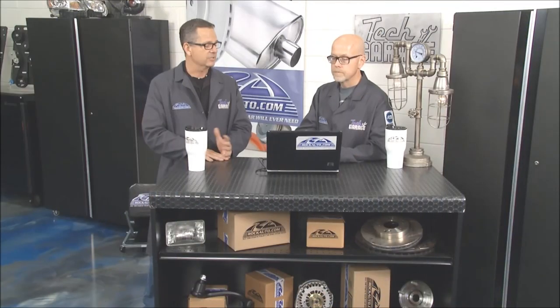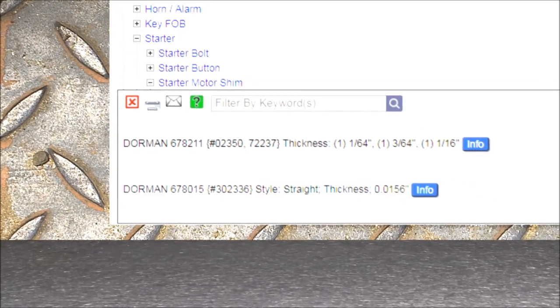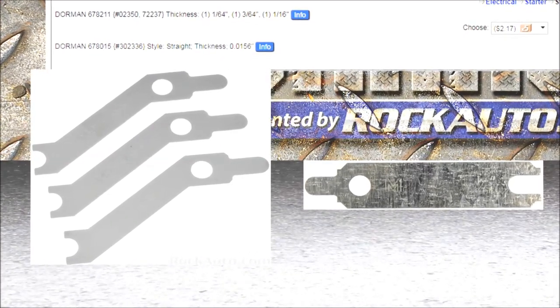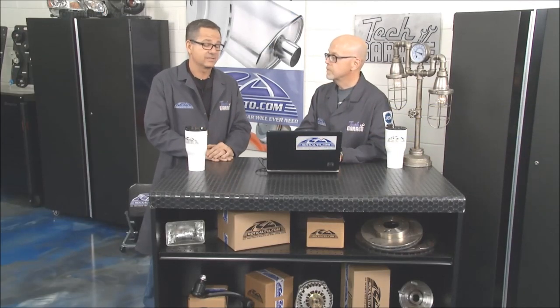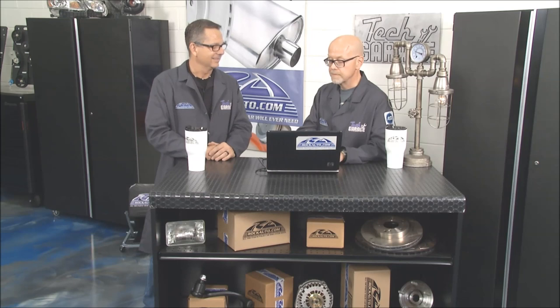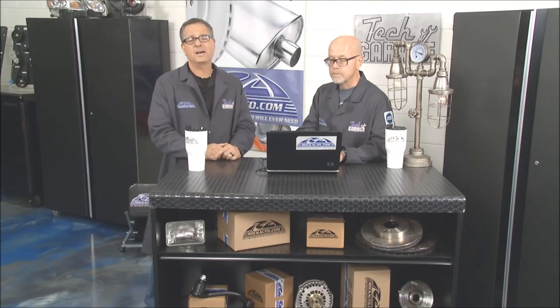Tom, you actually offer shims on rockauto.com, right? If a starter worked fine when new but stops retracting or extending the gear adequately, it might be time to get a new starter. Voltage drop causes counter-electromotive force issues — the starter draws way too much amperage and burns up. So: address shims, replace the starter if needed, check the bearings, try the old hammer trick, and make sure your wiring is good. You don't want to damage a brand new starter or replace parts you don't need to. We'll tie this in with alternators next week. Stay tuned — there's plenty more Tech Garage presented by rockauto.com right after this break.